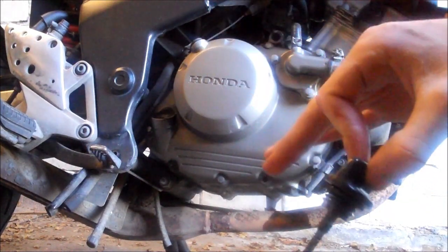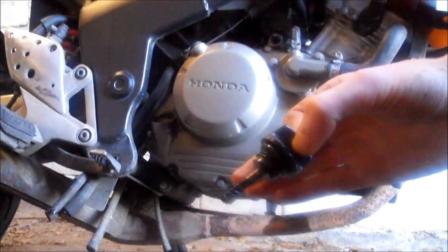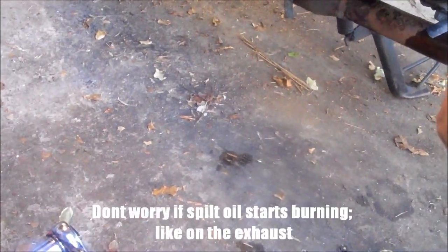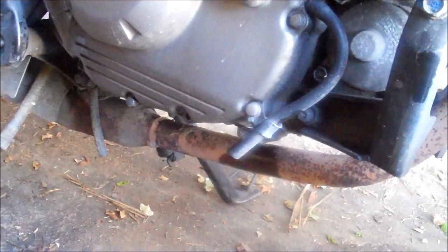It's better that it takes you five minutes and you get it just right than you bung it all in and it goes wrong. The oil has been topped up now and everything is done up to the correct torque. The drain plug isn't too tight. Now we're going to let the engine run for a couple of minutes with the fairing left off just to check for any leaking. Also, that seal ring on the drain plug should be checked to see if it's worn.